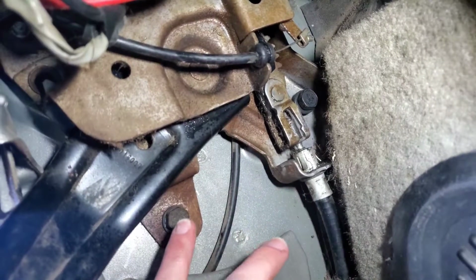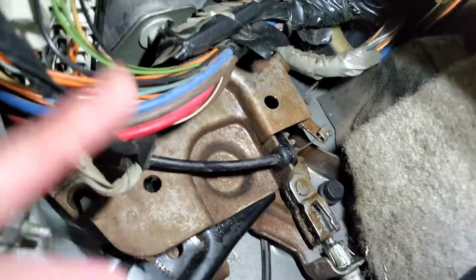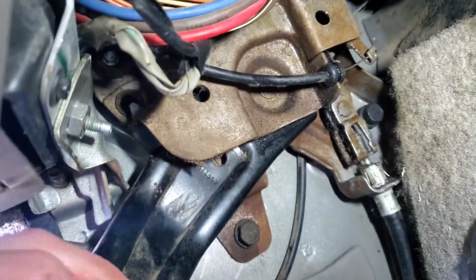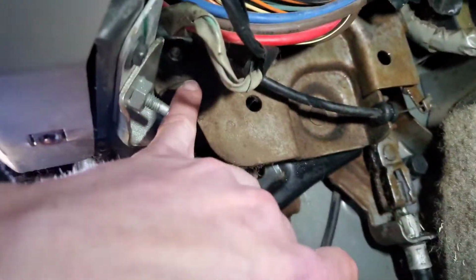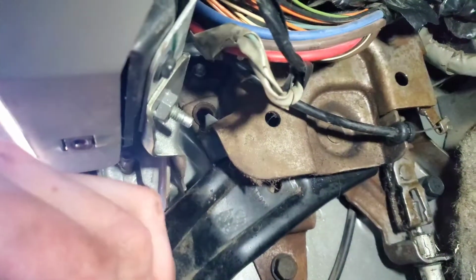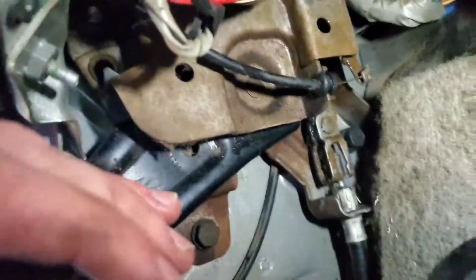So there are these two bolts at the bottom, which are 1/2 inch, and then there's a 1/2 inch nut that you have to go over the wiring harness. You can't even really see it, but it's back there. You pull that off, this whole mechanism can then snake its way down here. There is one connector on this harness. It's right here. You'll see it when you're pulling this out. You just have to unclip it because it's a grounding strap to the mechanism.